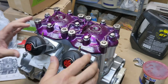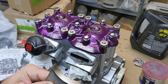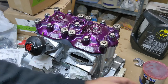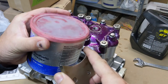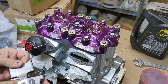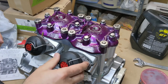So it does not. If it did, one way you can file those down, the best way that I saw anyway, I've never done it, is you take a piece of fairly coarse sandpaper, different degrees of sandpaper, and you take your old piston, and you just do it like this, and you just keep working at it until you bring it back by whatever, a millimeter or half a millimeter, whatever it takes. We didn't have to do that.